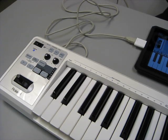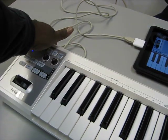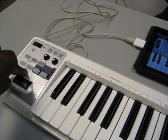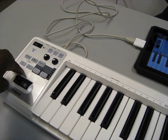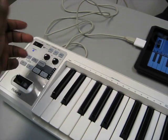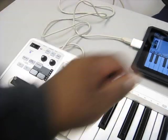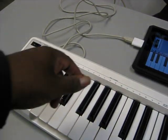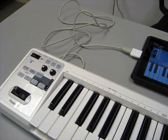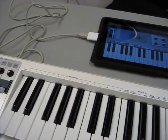This is an Apple camera kit. Some people are using third-party camera kits — what you might have to do is instead of doing the connection at the camera kit end first, you may have to plug it into the back of the keyboard first. So disconnect it from the back of the keyboard, hold down S1 and S2, and while holding those down, plug it into the back of the A49. First try the original way: plug your cable in the back, hold the two buttons, and plug into your iPad. If it doesn't connect, try it the other way.